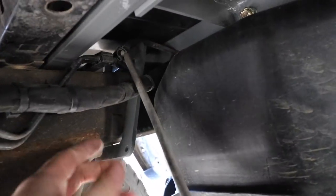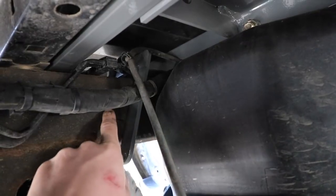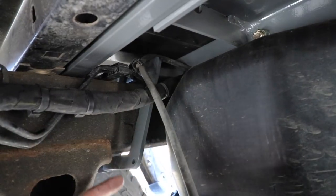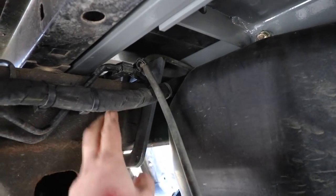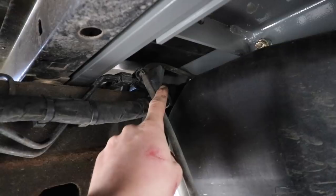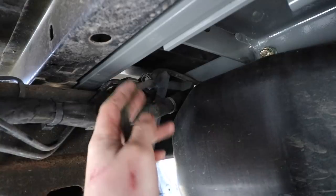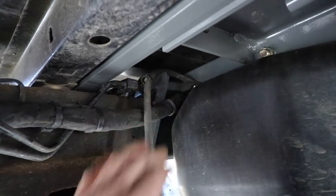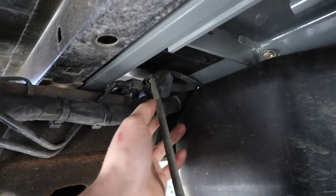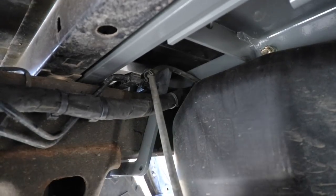Okay, so we're looking at the driver's side of the frame. If you look at that little zip tie right there, that zip tie was kind of holding this wire loom into the frame. What you're gonna need to do is pry that out, and then sneak this up in here and rotate it to the left. Hopefully you can see that the brake lines are in between this U-bolt and the frame. This tube right here doesn't matter too much. This is just a breather tube for the rear diff, so you gotta move that out of the way, that's fine. The only thing I'm concerned about is the wire loom is now making contact with this U-bolt,